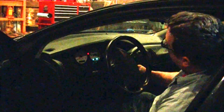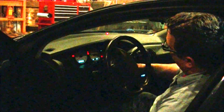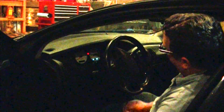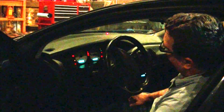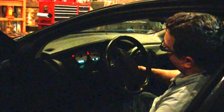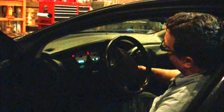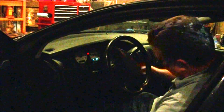So we start out, put the first key in, then we turn the key off, put a second key in, and we're going to listen for a chime. There's our chime, our light's flashing, turn the key off.